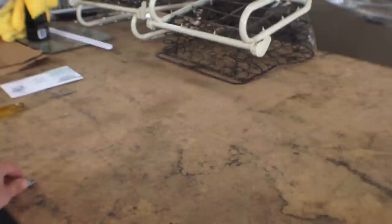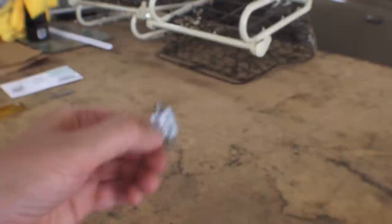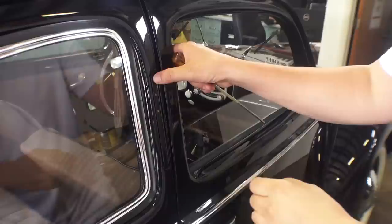Here's an original style bulb that goes into a semaphore — it almost looks like a dome light bulb. I found these on eBay from a guy in Australia who made LED semaphore bulbs. They're 6-volt and about the same size as the original style bulb. This is what we're going to replace to make our semaphores flash.